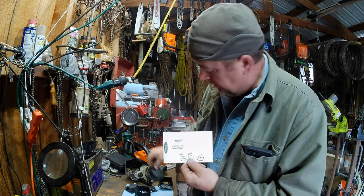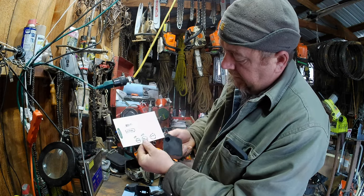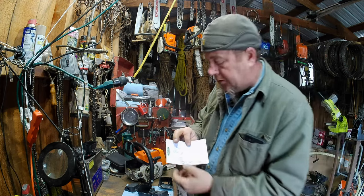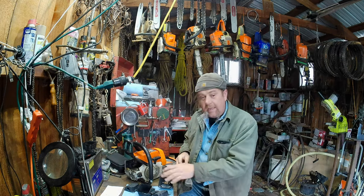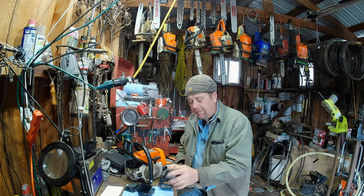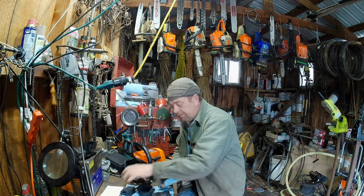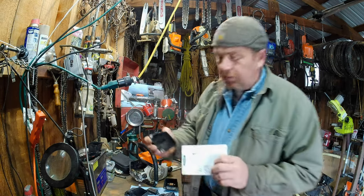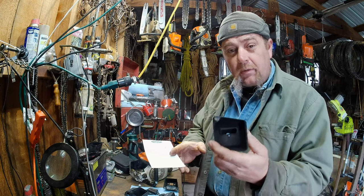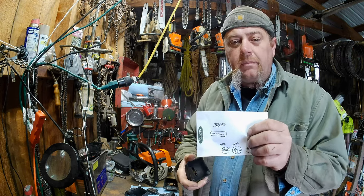The bark box area is a little less than the three-quarter inch pipe, and the three-quarter inch pipe is considerably bigger than the 610-thousandths pipe. That's a trace of the bark box — the best I could do. So there's the area we're dealing with on the exhaust. I assume the next video we'll start putting a bigger pipe on here, maybe shortening that one. We need to open this one up more. I want to keep tracking volume. We'll open the bark box up some more on the next one, and we're still not up to the original volume of the original Stihl 026 lid — we're at 0.581 square inches. Even our three-quarter inch pipe is still way below that, so we've still got the exhaust snuffed out a little bit.